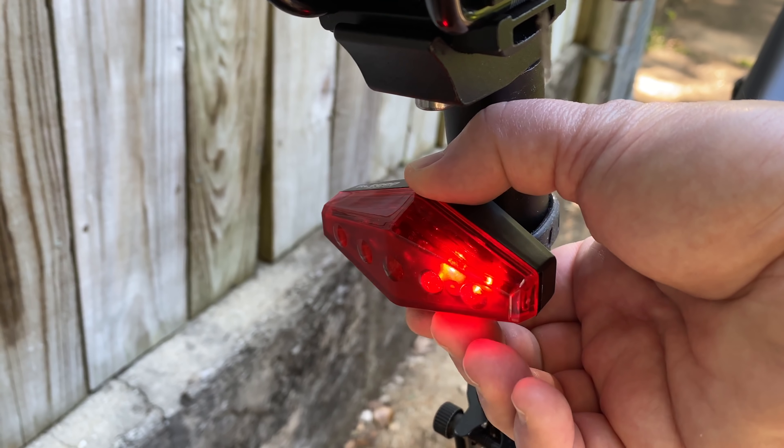On the trail I was unsure how this would work out, because hub-motor-driven bikes aren't ideal on trails due to the cadence-related on-off delays. Plus, at 350 watts — I've had 500-watt motor bikes out here and they kind of bogged down. There are valid concerns: that motor shutoff delay can be bad news on trail because even a subtle unintended boost can cause problems on turns, overshooting lines, or pushing into trees. And with no motor cutoff on the brakes to mitigate that, an extra second or two of power at the wrong time is unnerving.